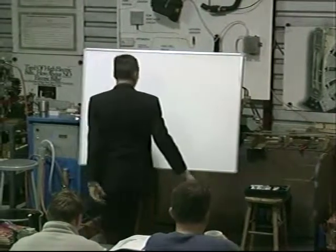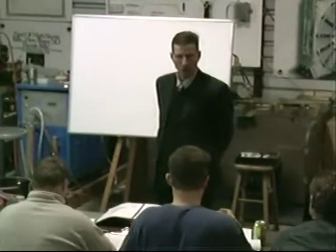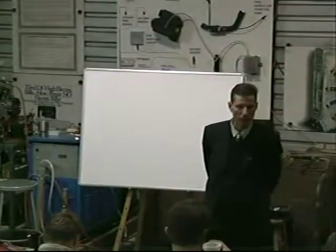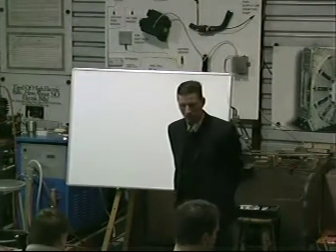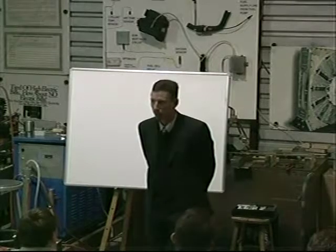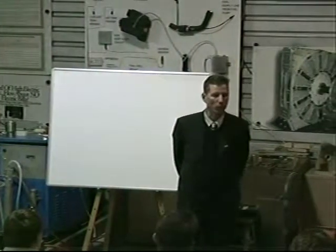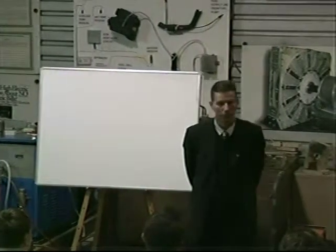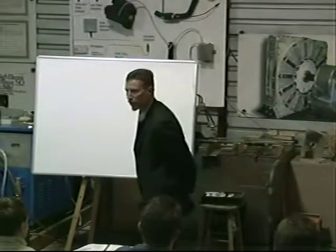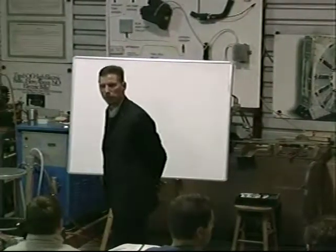And if we have the fuel coming through the injector at 100 degrees Fahrenheit, we're going to vaporize some of that stuff, because remember, it's going into a low pressure intake manifold that's under a vacuum the majority of the time. But what happens if we could send it in at, say, 160 degrees Fahrenheit? We'd vaporize a whole lot more of that fuel, wouldn't we? And the more fuel we can vaporize, the quicker we can get those OH radicals in there starting the combustion process.